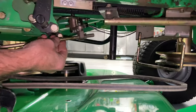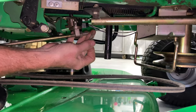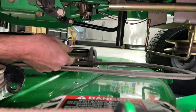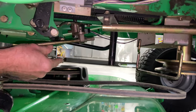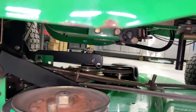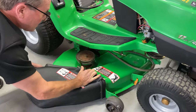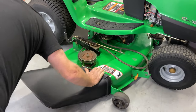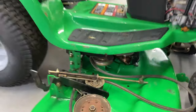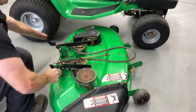While we are here we also have to take off the blade engagement rod, and there is a pin on top. Take the clevis pin off like that and then you drop it down, and there should be a washer on top — which there is. So there's a washer that goes on there, and when I put this back up in the hole right here I normally will put a block of wood to hold it up for me. Everybody with two hands should be able to hold one up and then put the other one in, but it's a little bit tricky. At this point we should be able to pull this out — be careful that you're clear of everything. It is hanging up a little bit in the back here. These arms are very strange to this mower so it got hung up a little bit right here. You just have to be aware and it'll come out, and I definitely recommend if you can do this on asphalt or concrete it makes it a lot easier, but you've got to do what you've got to do.